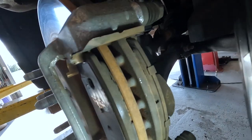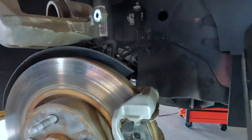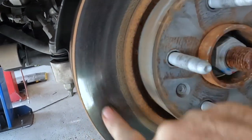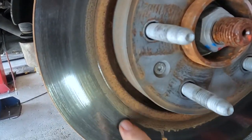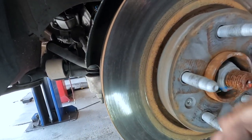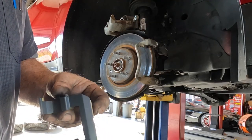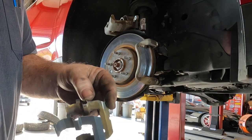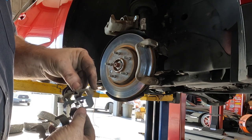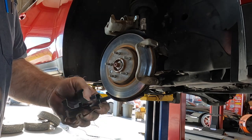About halfway worn, like I suspected, but they sold brakes so we're going to do some brakes. I'm not even going to machine the rotors — the rotors are perfect, no reason to take metal off of them. It looks almost like they'd been machined at some point, or it might just be from rust from a short trip. The hardware is bent very nicely, just off a tiny bit on the bottom ledge, but I'm going to use it because it's coated and they're actually really close — shouldn't cause a problem.